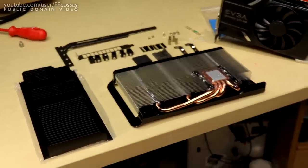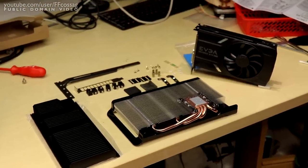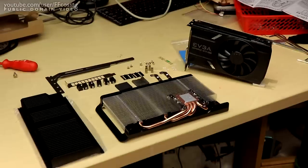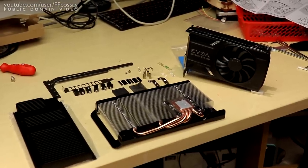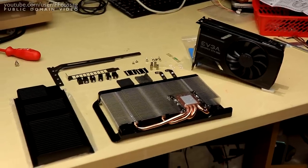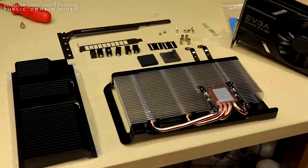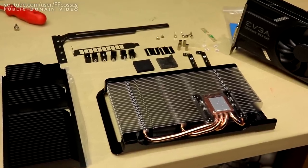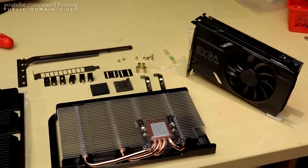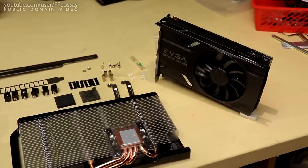So we're going to be hacking this up and cutting that down to size to make it fit my card better. The reason I chose this particular graphics card over any of the larger designs — which were actually cheaper — is that I want to be able to have the heatsink extend off of the end of the card in order to get more air flowing through it. Having that big heatsink just shoved up against the card is not going to make air flow very well through it at all. The less PCB area you have on your card, the better. So let's get to disassembling this card and seeing if this thing will even fit. The S3 is so old that it doesn't really have any of the newer Pascal GPUs specified, but I think we can make it work no matter what.